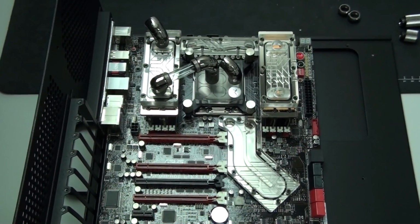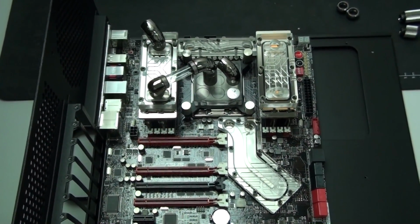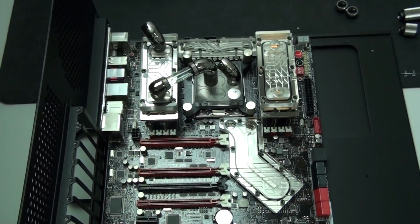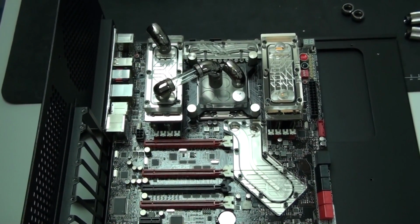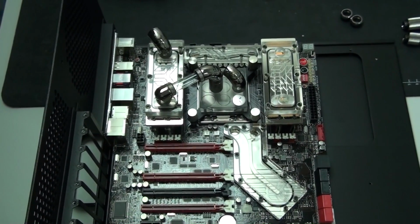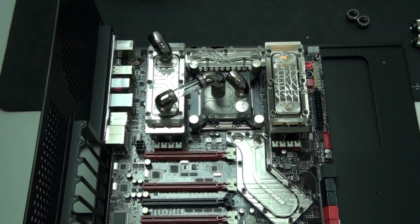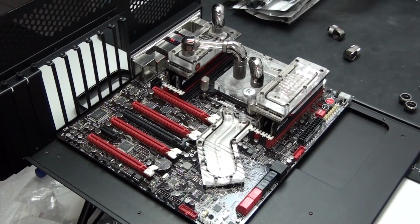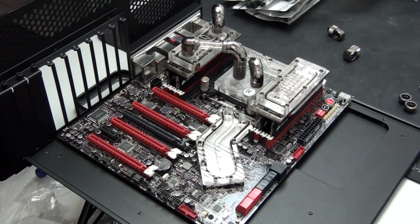And the good thing is, being a different case, having a different tubing routing was necessary anyway, because the radiator is actually above the motherboard, so the first tube is going to come in from the top. As you can see, I have that 90-degree dual rotary pointing out to the top left-hand side there. That is where the tubing is going to come into this configuration. Now, because of the different tubing routing, it means that I need to use different fittings, which is again going to give a completely different aesthetic. And what I have decided to do this time is actually add some more curves to the configuration, and the way I'm going to do this is by using more 90-degree dual rotary fittings instead of single rotary fittings.